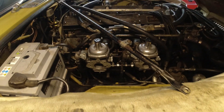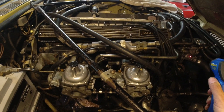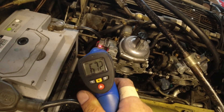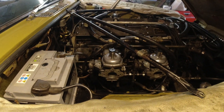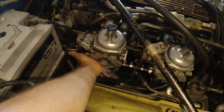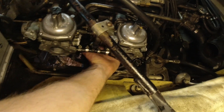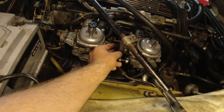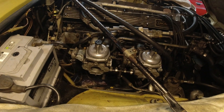We're starting to get some heat in things. We're at 80 degrees at the thermostat housing, 66 there, 69 there — so the thermostat hasn't really opened yet, and they're pretty even. It is a lot, lot better than before — it's not burning my eyes anymore. The air plunger, the idle kickout, is really going in all the way on this one; the other one is starting to. So maybe it's just some air, maybe this one's a little bit slow. If not, I'll take the housing off and rotate it even more to get it to turn off more fully. I can still lean them out a little bit more — they're both a little bit rich.